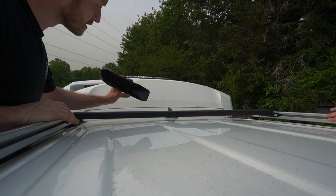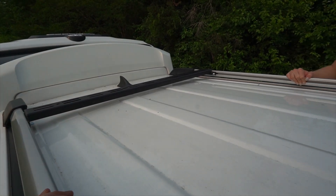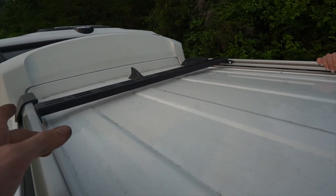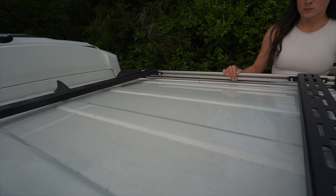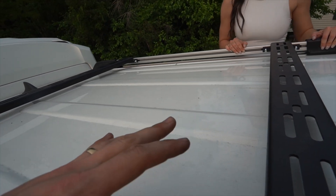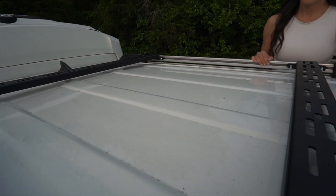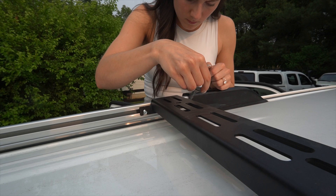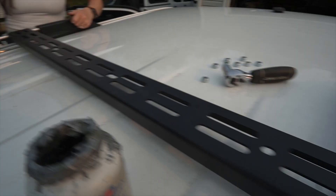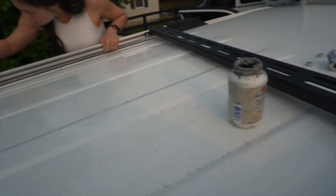Next we go ahead and pop these caps back on — it's a simple clip, just like the way you pulled it off, put it on and roll it back on. With our rails in place and caps on in the back, now we're just going to figure out where we want these bars exactly. We think we want this one as far forward as it can go and pretty much the same for the rear, since we're going to be putting a rooftop tent up here for our trip to Wyoming — it just makes more sense to have the load dispersed. You can even buy multiples of these and mount different stuff, but we're just going to go with two to hold the tent. Now we're brushing some anti-seize on our studs — even though this is stainless steel hardware, it's still susceptible to rust being up here in the elements, so just a little dab of never-seize on the studs goes a long way. Once we get that on, we can get our nuts on and tighten them up.